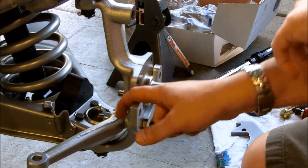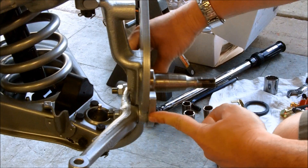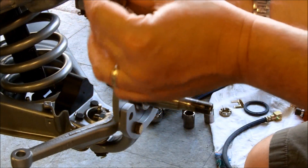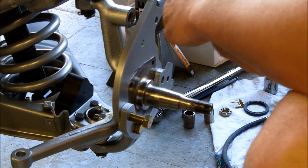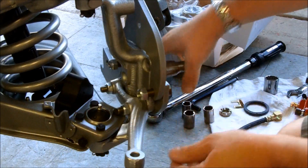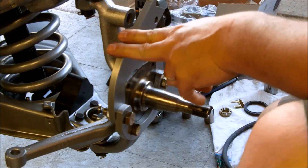Now I've got these tightened up. Next we're going to put on the brake caliper bracket. As you can see, the way it fits it's perfectly flush, and it came with two bolts with self-locking tops — different sizes but they do the same thing. So we put one in and then the other one, get them threaded. Everything fits on here nicely. Now we've got the brackets done.